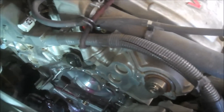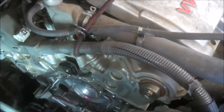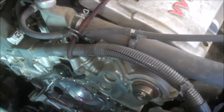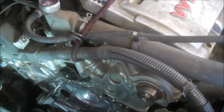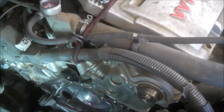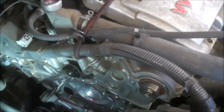I've heard about people who pull off a water pump and the gasket stays on the vehicle nice and neat. I've heard of people just using a little bit of silicone on the water pump or whatever they're putting back on the vehicle, and siliconing it and bolting it back up. I can't necessarily say I recommend that, but it certainly is an option — last resort.